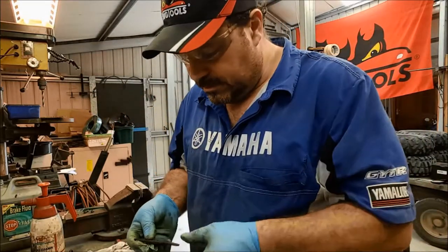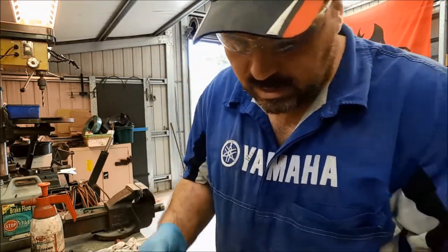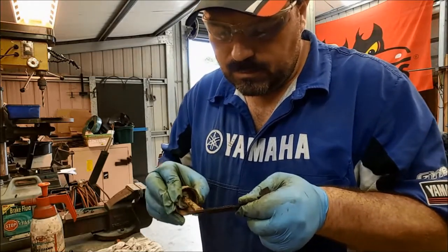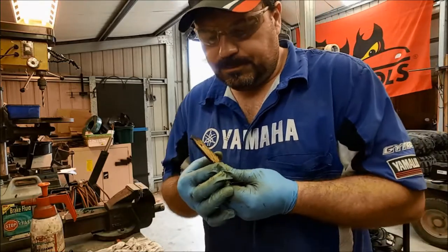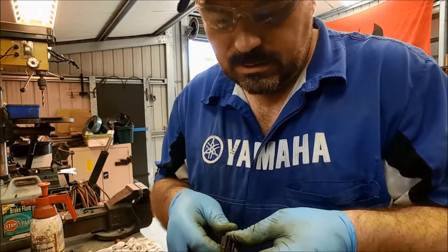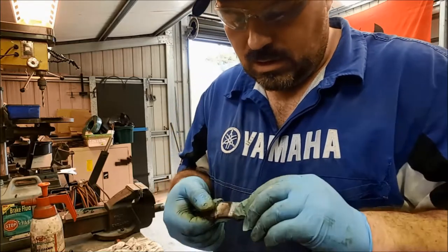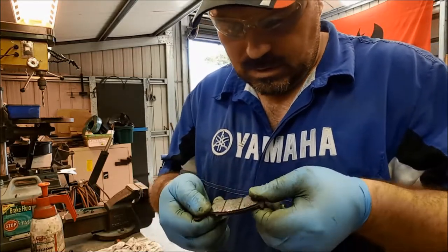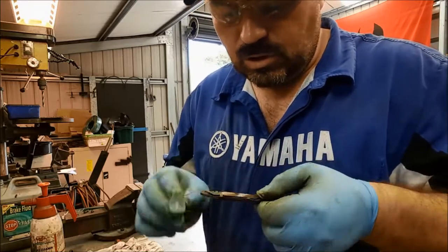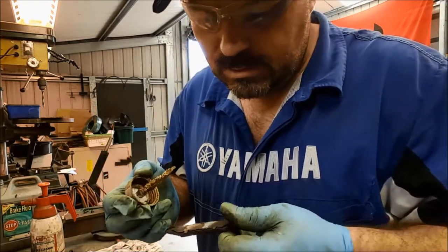These are anti-rattle shims. Now we're going to put the pads back in again, the old ones, because again, if we're going to be fitting a seal kit at some point in the future, then it's all good. Okay, copper paste on the back of the pad. That then goes on, you then put the anti-rattle shim on there. Okay, so now that's in place. It's all a bit bent, unfortunately. There we go, that's better. All right, and then we should also put copper paste where the contacts are made.